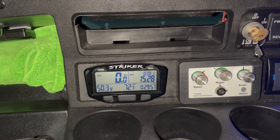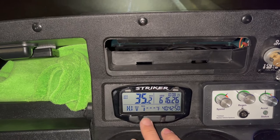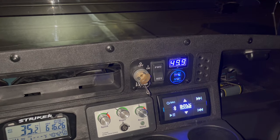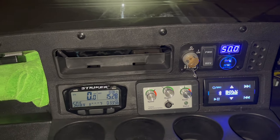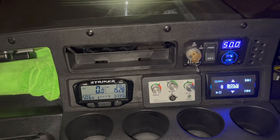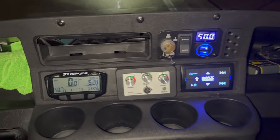We're just a little over 15 miles — 15.28 miles. Got a max speed still of 35.2, average of 27, and resting voltage of 49.8 to 49.9. I can definitely tell we're getting real close on the battery because it's starting to slow down on acceleration mainly. We're right at almost half of what my 120 amp hour pack has gotten me on the range test, so this is kind of about where I would have expected 60 amp hours. I'm going to take it back home and hopefully I make it.